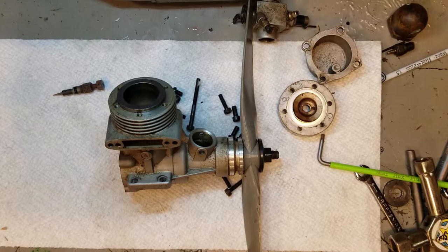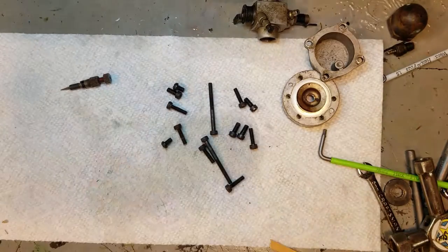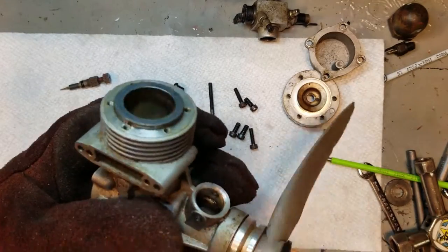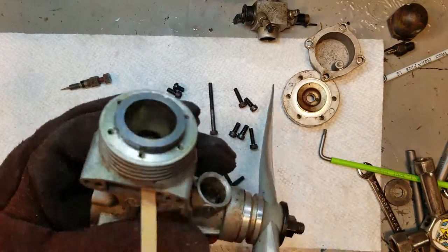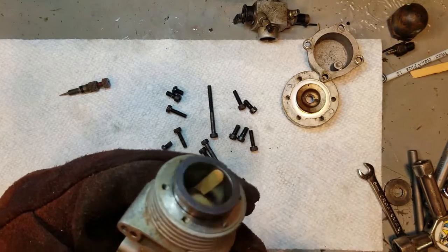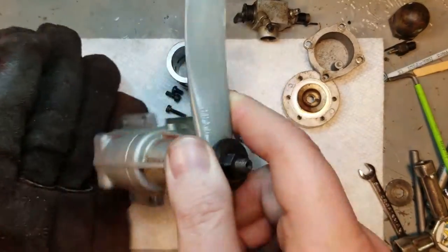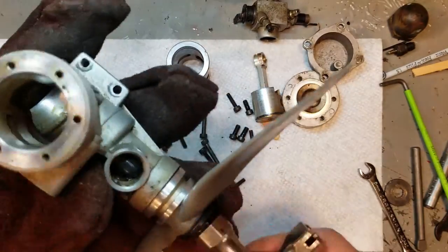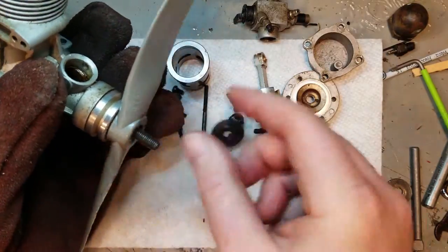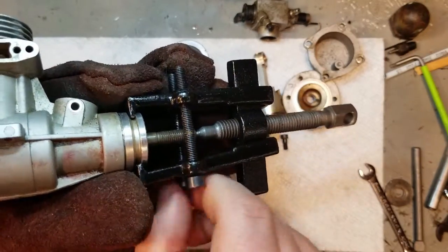I'm gathering my workbench prop here so we can rotate the assembly and push the sleeve out after we heat it up. It's a nice old pusher prop. Here I'm firing up the heat gun to get the engine pretty warm. We'll get a nice popsicle stick just to get the liner to pop up a hair. Now I'm off camera, just getting it propped up the rest of the way. Pull it out with a towel here because it's pretty hot, but not screaming hot. Didn't need to get it too cooked.